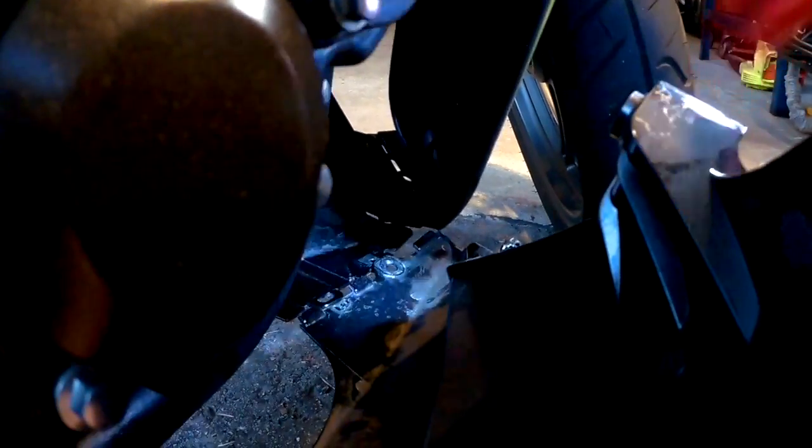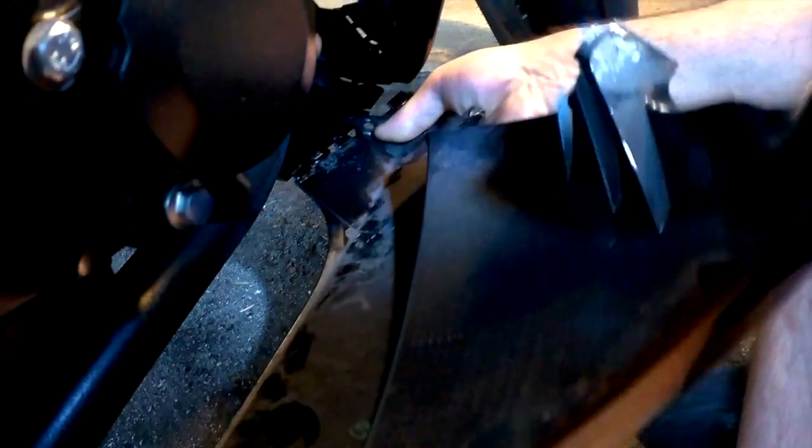So, like we showed you earlier, the male and female parts sort of snap in together. You have to make sure that that center hole is lined up with the metal little socket there so that the screw can thread in. And it is a little bit tricky, but it can be done, obviously. And it helps to have someone hold the fairing for you. And the cameraman, I'm not doing a very good job here, but looks like he's doing okay on his own. So you want to make sure it is lined up perfectly.